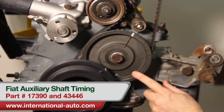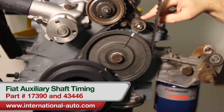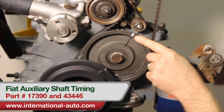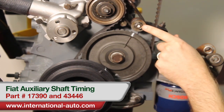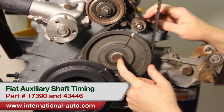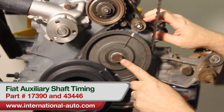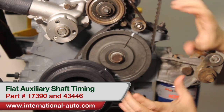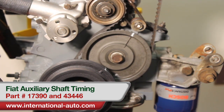This is the auxiliary shaft pulley right here, and this is the tensioner spring bolt. There's a mark here on the pulley, which we've highlighted in white, and we put a white dot on the head of this nut. The way to time it is with number four cylinder at top dead center — you want to line these up straight in line, and they're roughly at almost one o'clock if you're looking at a clock face.